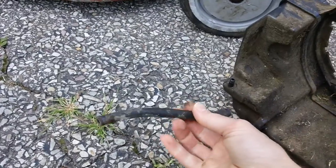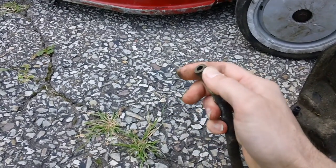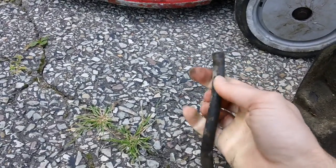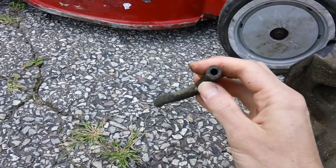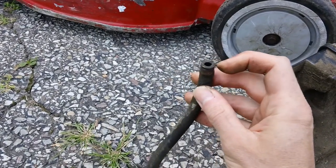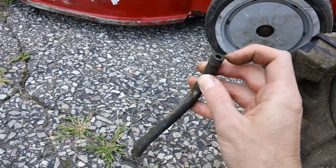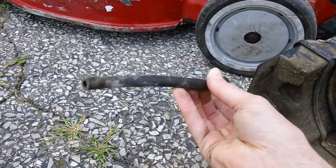Here's the old tank, the fuel line, and the cables. Here's the old fuel line — this is what a fuel line looks like after about 20 years. It's totally rotted, getting all cracked and frayed, and extremely stiff. We had to replace it because it would not seal correctly. It's always a good idea to replace these fuel lines because over time they swell and get contamination — water contamination is one of the biggest things we see. The inside diameter of the fuel line can turn white inside, typically caused by fuel contamination.